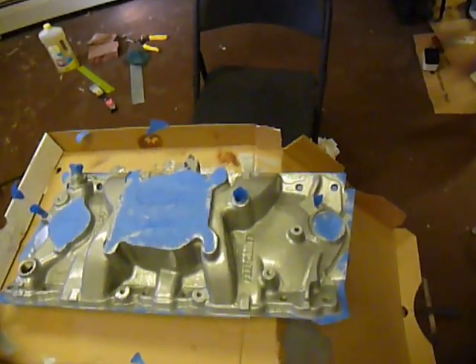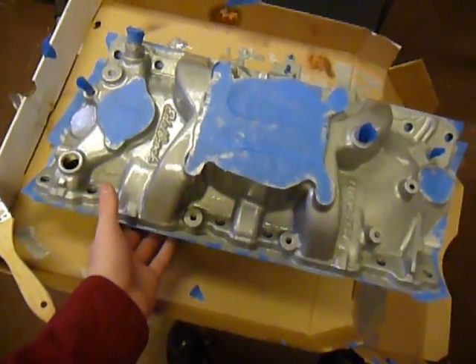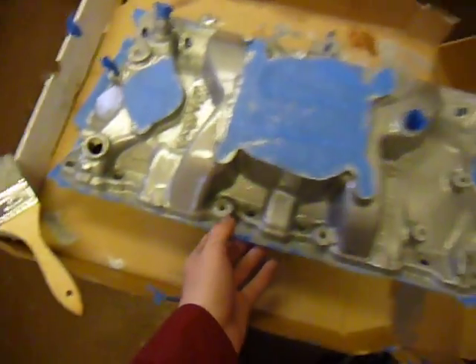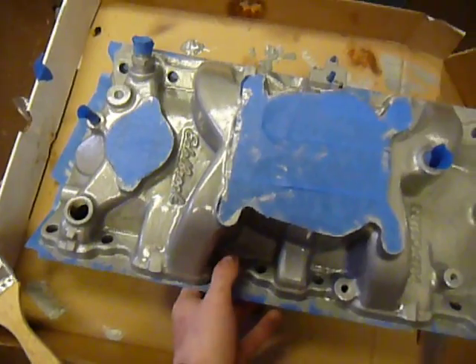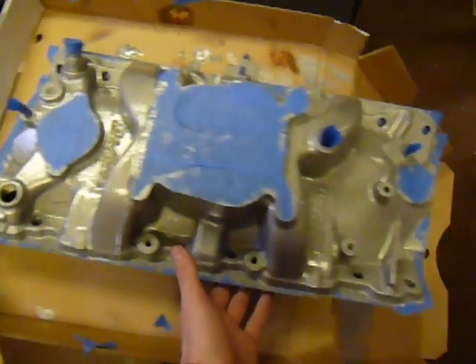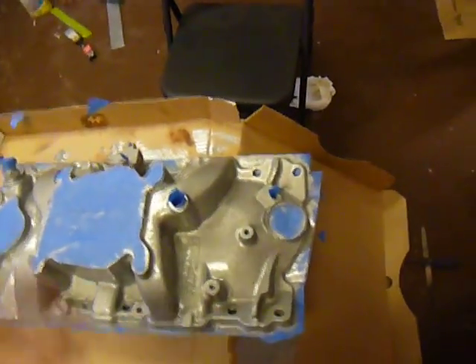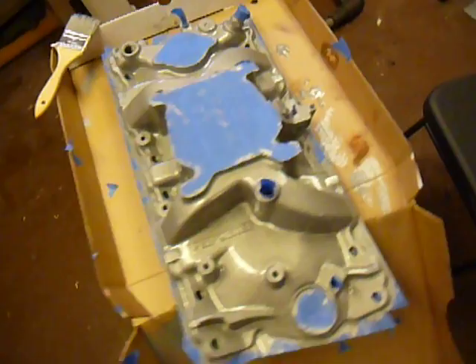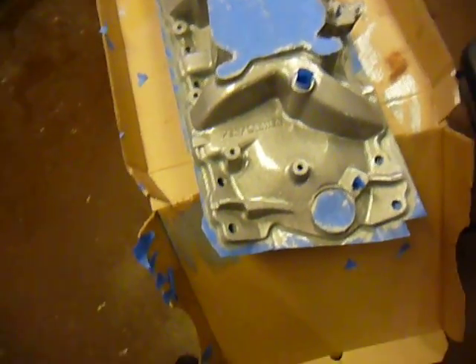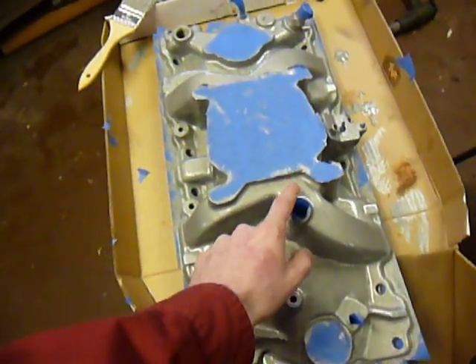First thing: you've etched your intake, you're ready to paint it, but you need to tape it off. What I do is I overtape. The biggest thing is you just want to get any of the mating surfaces on the intake where the holes come through — the bolts that hold it onto the head. You want to make sure that you have tape pushed down on the backside, because you do not want this paint to run through and get on your mating surfaces. It takes five minutes to tape it and will save you a bunch of time and headaches. I also tape off all the holes where you're going to put bolts in or threaded plugs.